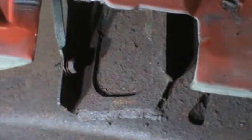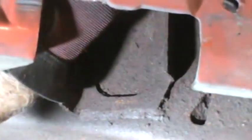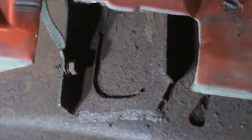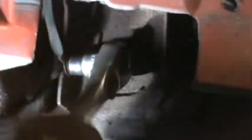Actually with the bolts removed, that canister was able to be pushed up out of the way - I didn't even cut it. This side broke off pretty easily, took like two turns with the breaker bar, and it came out. There is one other thing on this side - a ground strap. Looks like it might be three-eighths. That has to be removed because it connects the body to the frame, and that's what we're trying to get rid of - any connection between the body and frame - so that when we lift the body we don't have anything pulling up on the frame and ripping it out.